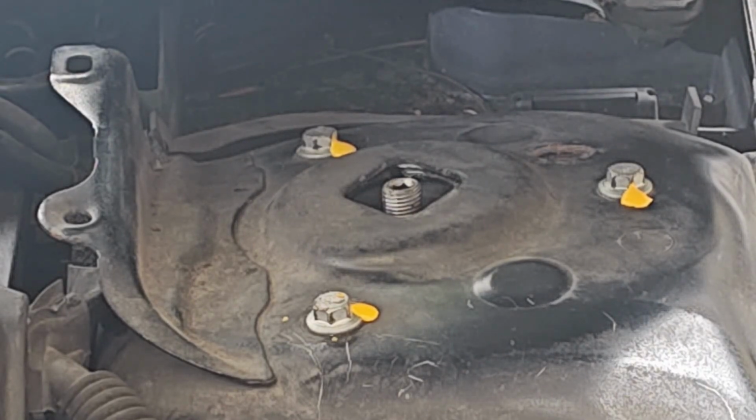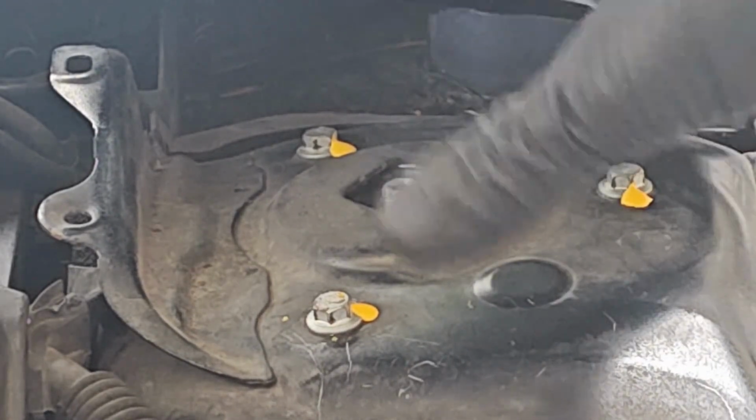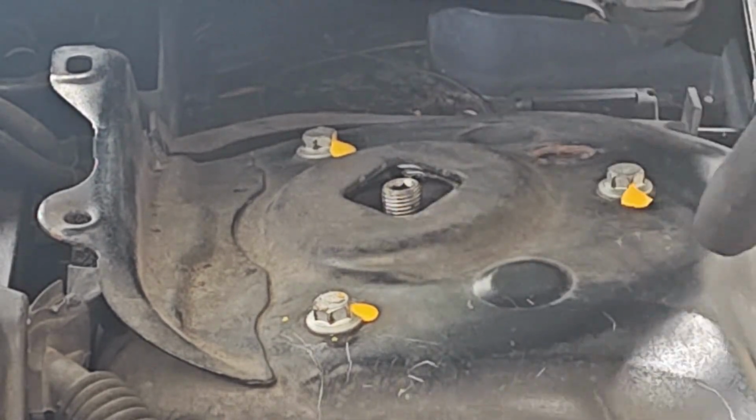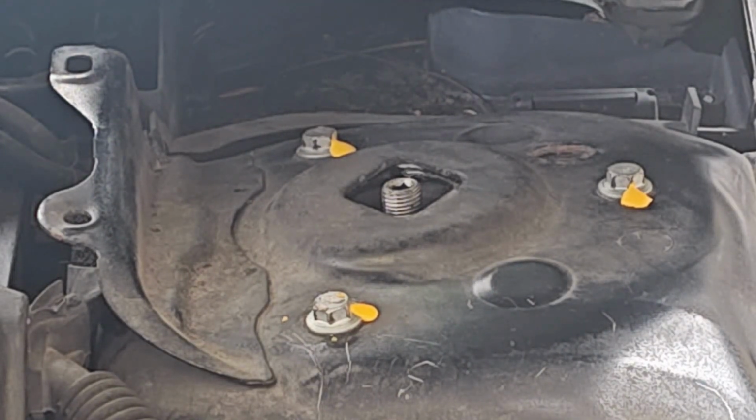This particular car is a 2011 Volvo. It's got about 220,000 miles on it. So it seems like things are always shaking and working their way out. But the warranty torque seal I think is a great way that I find that's easy to use. And it's a way of making sure, again, that the nuts don't work themselves out and that I know exactly what's going on with their position over time. I think this is a great product.